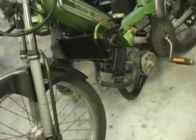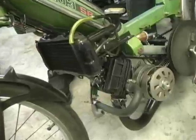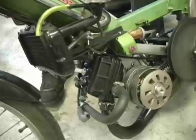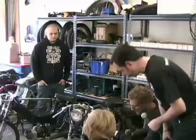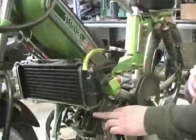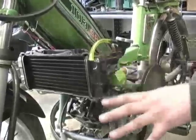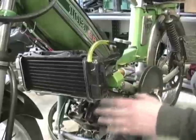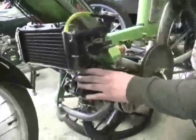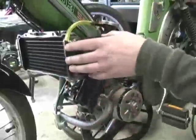It rains a lot. Okay, so tell me about water cooling, because I've never seen water cooling on a moped before. Generally the reason bikes have gone to water cooling is because it keeps the cylinder at a more consistent temperature. In this case I actually installed all of this because these bikes are air cooled from the factory. This is an aftermarket cylinder kit that allows you to switch over to water cooling — I borrowed a scooter radiator, built the brackets for it, and used an automotive water pump on this side of the bike to circulate the coolant through the bike.